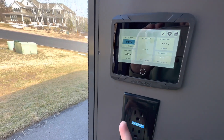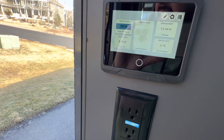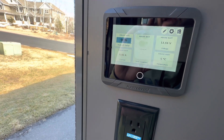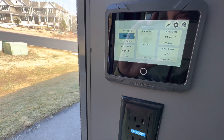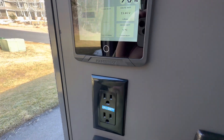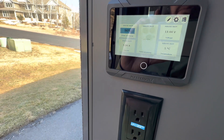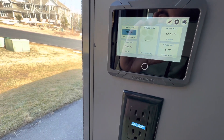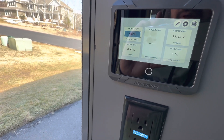If the battery temperature gets to zero degrees Celsius — or 32 degrees Fahrenheit — these batteries will not charge. Lithium-ion batteries can actually become damaged below freezing; a metal plating starts to form on the inside, damaging them if they charge below zero Celsius. This system does have a heater underneath it, but I've found the heater only runs when you plug into shore power. The heater will warm the batteries above zero Celsius and allow them to charge. If you're having trouble with that, just warm up the back of the van above zero degrees and you'll be able to get a charge.